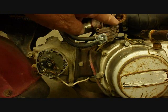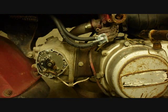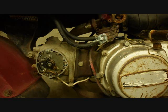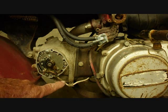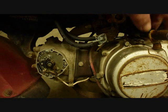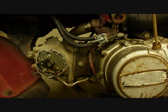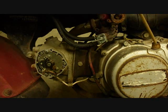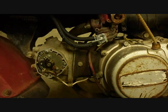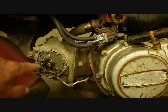Part of the wire splits and goes down here; another part splits again and goes to the front where the headlight is, and also over to the coil on the other side of the frame. Now let's talk about the part that goes to the points. You'll see most of the time the points are closed — they just closed, they're closed, and they just opened. So most of the time when they're closed, this circuit is grounded out.